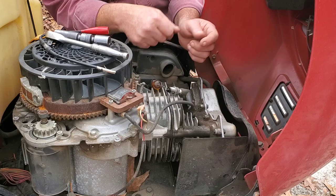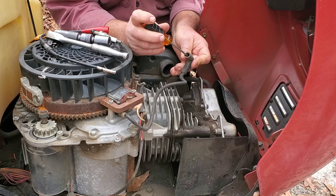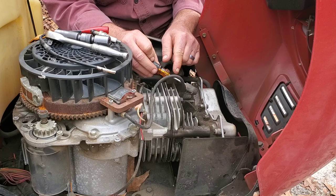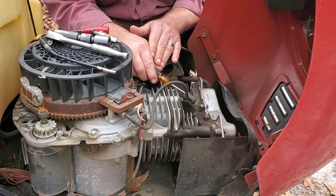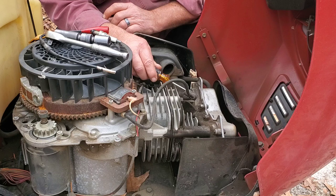So let's say you don't have a spark tester and you don't have another spark plug — same thing. Take a screwdriver and stick it down in here, up inside between the rubber and the metal. Don't touch it because it's going to light you up. Hold it really close and spin the key over and see if you see spark jumping from your screwdriver to the head.